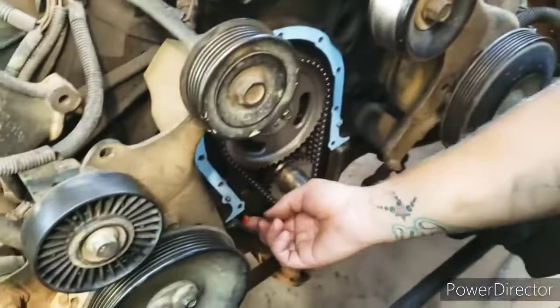But it was the same way with the flex plate bolts, the 6 that go to the crank. The 7.4 liter, it was a lot lower than the 5.7s. I don't know why that is. But I'm cranking the torque converter bolts to 65. That's what I'm going to do. You guys can do what you want to do.